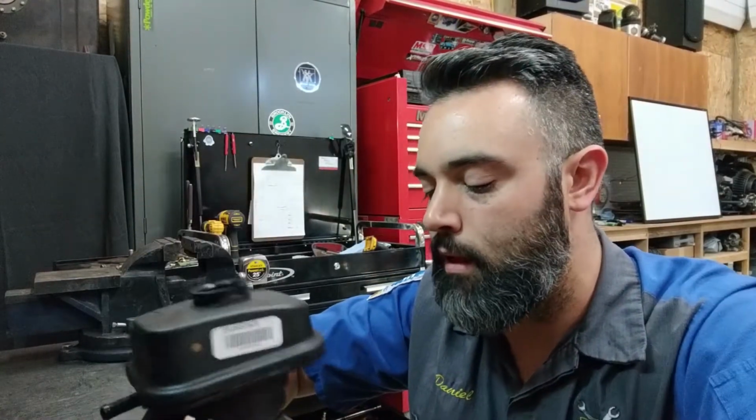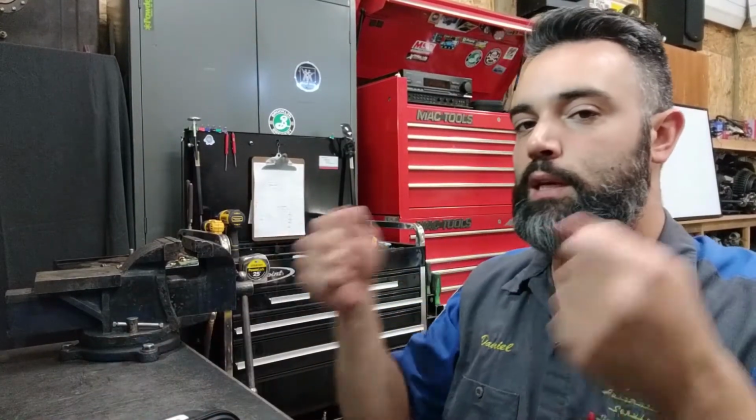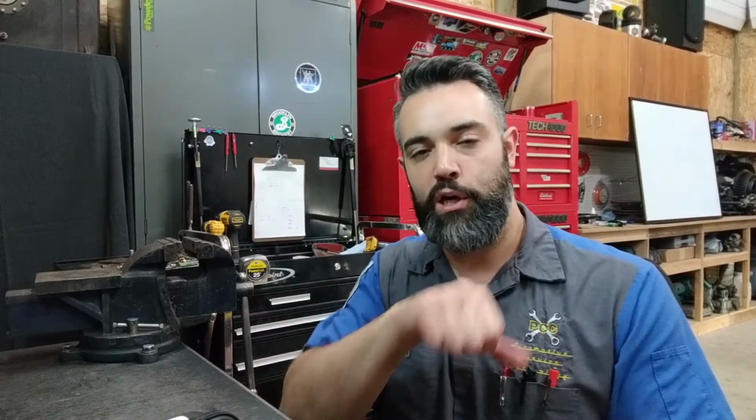So when would that be? Well, when driving straight, for one. When the steering isn't being used, if you're driving straight, there's zero turning left or right, and there's no need for power steering. So the power steering pump is going to continually be circulating the fluid, and the restriction is the steering gear, and the resistance is the tires in contact with the ground with the vehicle weight on it, and all the other components that are moving when you're turning the steering wheel. The slower you're going and the farther you're turning is going to require the most amount of pressure.